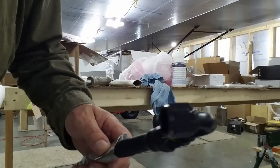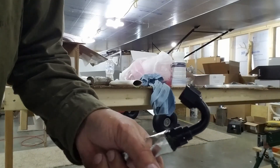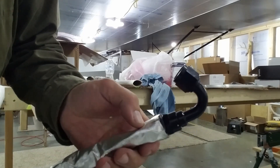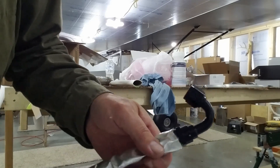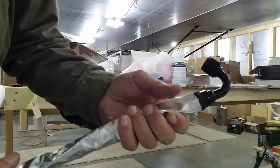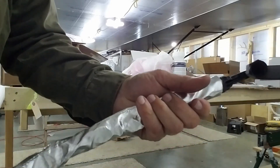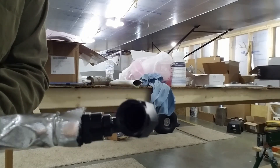That's all there is to it. Once you get it down there and it's set on good, I'll actually safety wire it. There's a little groove here in that nut - I'll put a piece of safety wire around there to hold the outside safety shield on there. There it is, safety wired - she's ready to mount.